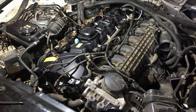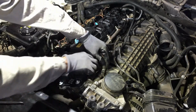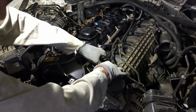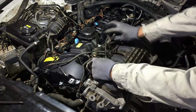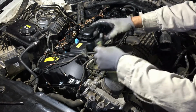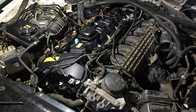Hey, let me show you what I was talking about on the connections. You know, they practically fall in place like here. No brainer. Swing these two. Okay, where do you think this connection goes? There's one right there and then one right there. Look at where it falls. Now you're gonna do this number. Look, you can't even reach it. If you can, it's gonna be stretching the wire, so they're not gonna do that. So this one goes on the bottom right here. Bam. And this one goes right here. There. Same with the O2 sensor connection. You think it's gonna go here and then, well, yeah, that's the way it goes. Or do you think this is gonna go here and you're gonna have all this left? This one goes right here, guys. And you can also mark them if you think you're gonna mess up. Put some paint on it or something. See, that makes more sense, you know. You don't have all this excess wire. Anyway, just thought I'd throw that in. Make you feel a little more comfortable when you do this.